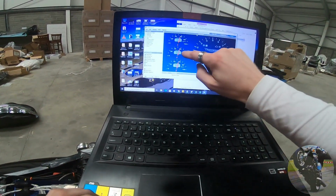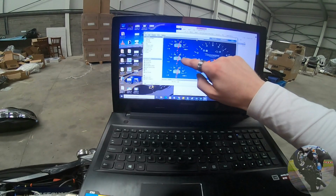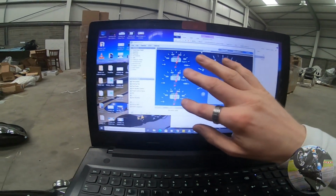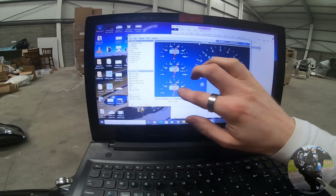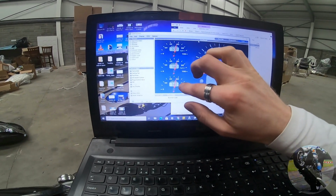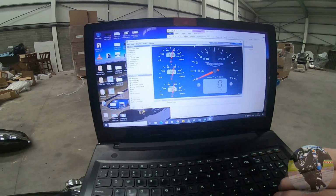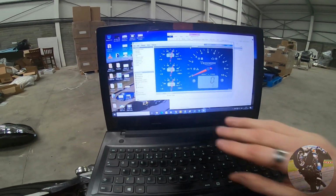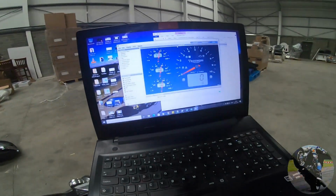Like I have 570, 580, 560. So that's not really within 10 of each other, because there's a difference of 20 between 560 and 580. So it's a little bit of an imbalance. So what I'm going to do now is adjust it and try to get 570 across all of them.